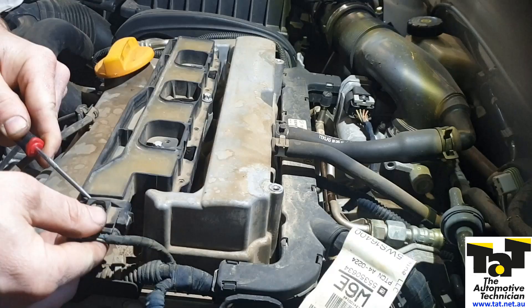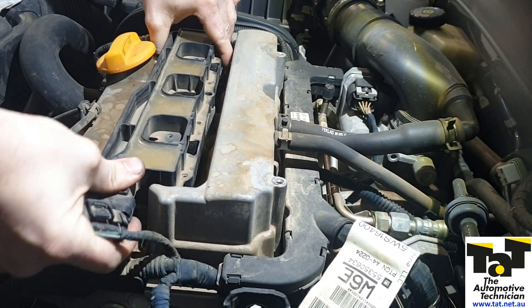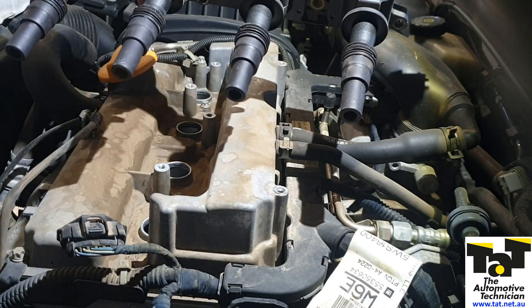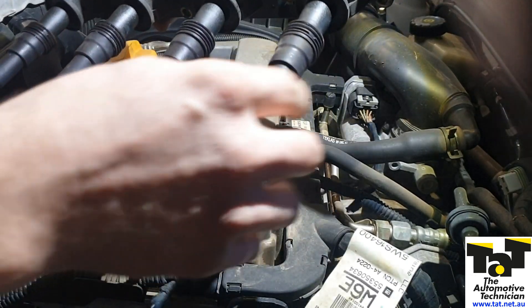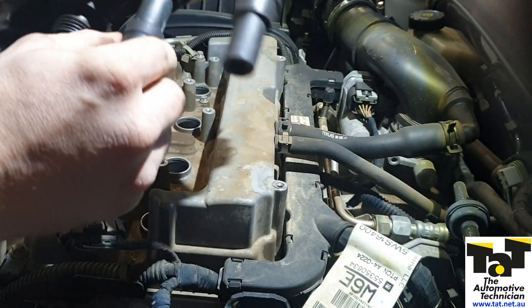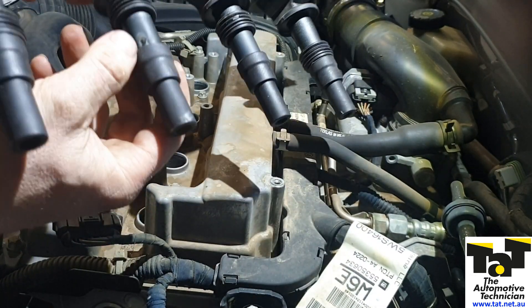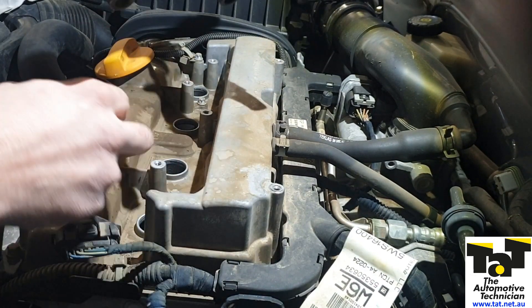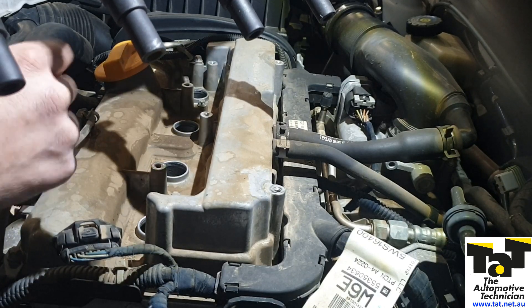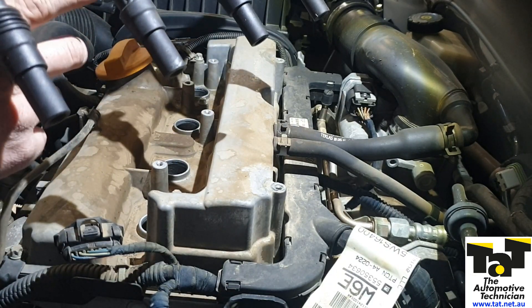Okay, so we've got our coil out. First of all, we'll do a visual — have a look around. Looking okay... Bingo. So that's all we needed. Pulling up that little sheet in there, you can see it's definitely burnt through this coil. There's very likely going to be high secondary resistance on the plugs — I'll check them and see if they're terribly worn out. Because it's been so difficult to jump that secondary, it's found another secondary path through the insulation of the coil, and that is a bad one — terribly burnt and obviously jumping out to the side of the head.